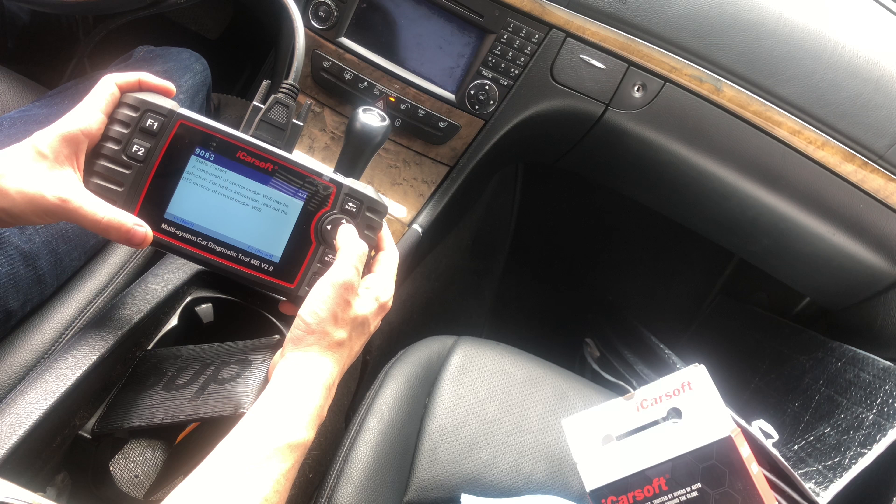Now that the car is on, we're up to about 13 to 14 volts — giving that battery a little bit of juice. Very close to 14 volts and staying pretty consistent. You can see when I turned it on, the voltage went up and then stabilized. I did have the AC on, which is probably why there's a little bit of additional draw. As soon as I turn the AC on again, it drops a little bit. And if you turn on your headlights, you're going to get even more voltage draw — there are a lot of things drawing power we don't realize.